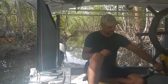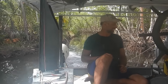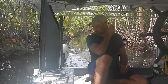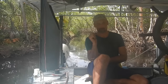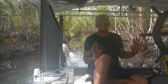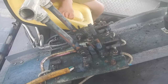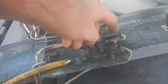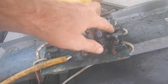Let's just see that one more time. I think it's going to go faster than it ever did with that old speed controller, because I think that speed controller was limiting the current to not the maximum power of the motor. So I think we'll actually go faster in this boat. When I made this switch, I made sure that it could contact the first two positions way before it contacts full power - so that'll work out really well. Full power is hitting those contacts.